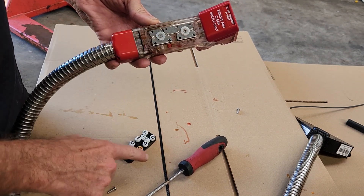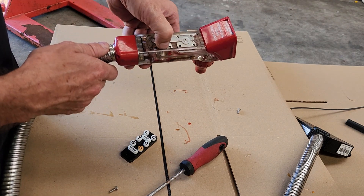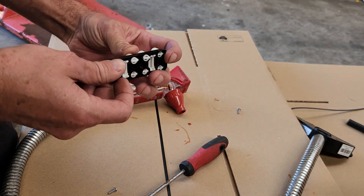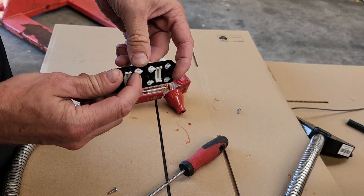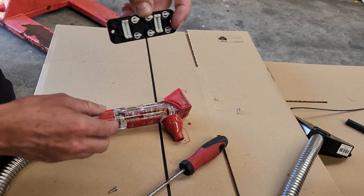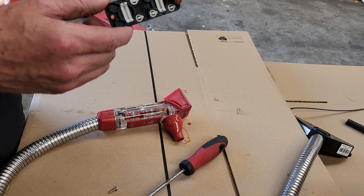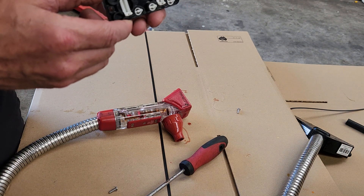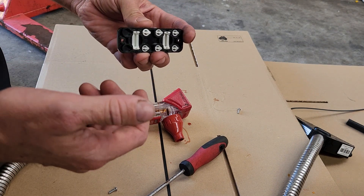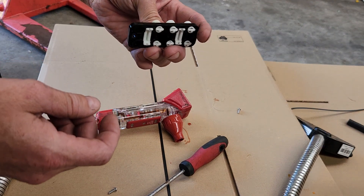If there's no water when you press the orange juice button but water comes out when you press the plate down, it's a button issue. On the bottom of these buttons there is a spike - that spike goes through the hole and pushes down the syrup. There's also a bar on each side that pushes down the plate. Sometimes buttons can be defective or damaged and that bar doesn't push the plate down, in which case the button needs to be replaced. They're worth about 50 cents.